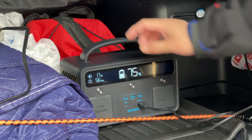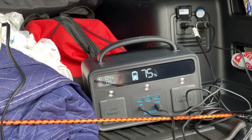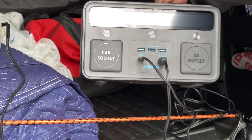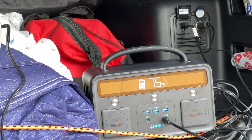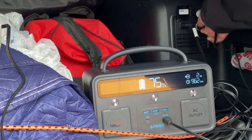I started my vehicle and got 14.4V output from the cigarette charger port, allowing me to charge this device at 55 watts. With my car's AC power option, I doubled the charging input. The downside is that the battery outputs 12.2V DC, so in accessory mode with the car off, I was only getting 12.2V and could not charge this device. You need 14.4V or more to charge the Anker Powerhouse 2 via DC input.